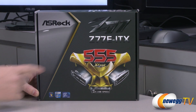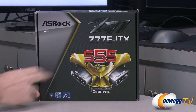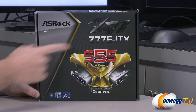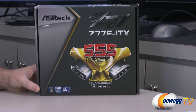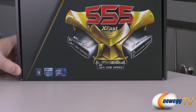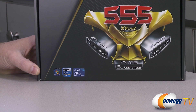There's a lot of information that can be derived from a motherboard's product name. Simply by looking here we can tell this is a Z77 chipset motherboard. It's a mini-ITX form factor, which means it's very small. The Z77 chipset is of course based from Intel, and that means it's a socket 1155 motherboard. It will support Intel Core i3, i5, and i7 processors.